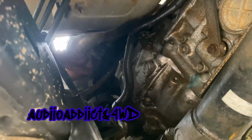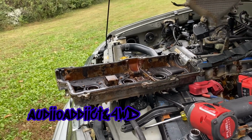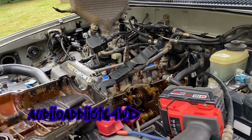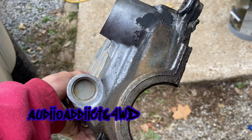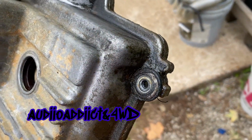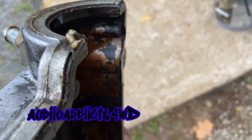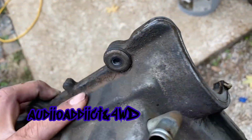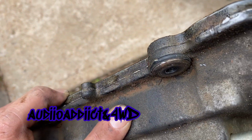I don't think it's from this, it's from all the way up there. And every time I run the car, it smells like oil. I'm glad that I'm gonna be changing all this. Put my hands on it, start cleaning this first, and then doing all the seals. Now, as you can see, this goes like that, right? So you can see a major leak right there, a little bit there, some on this corner. On top here wasn't that much. It was on the bottom from the cam plug, not from here. And up here, of course, this is a slight amount of oil.